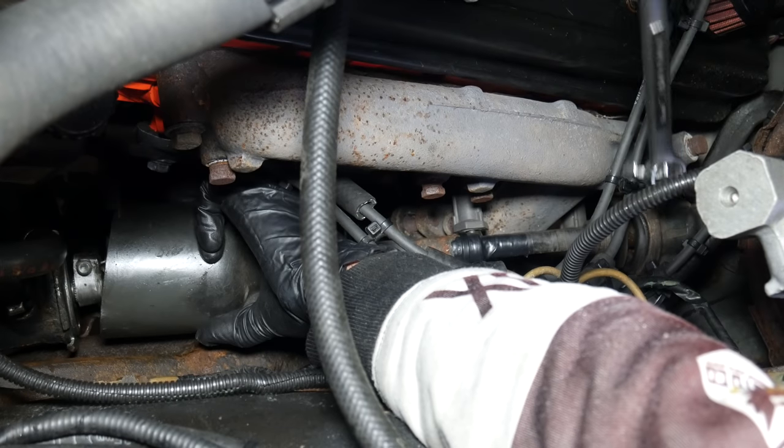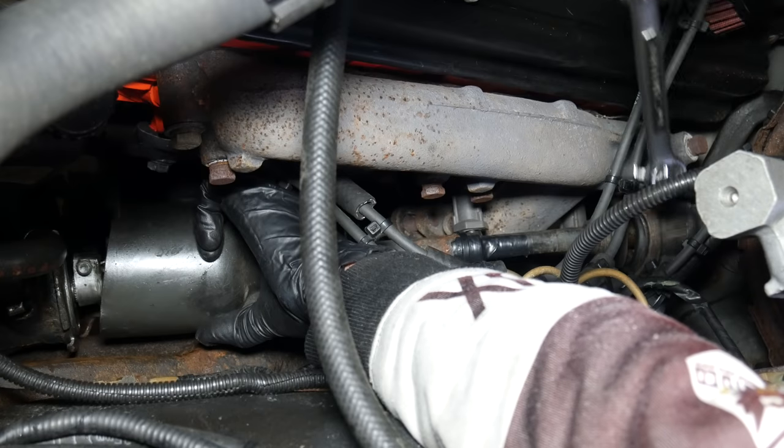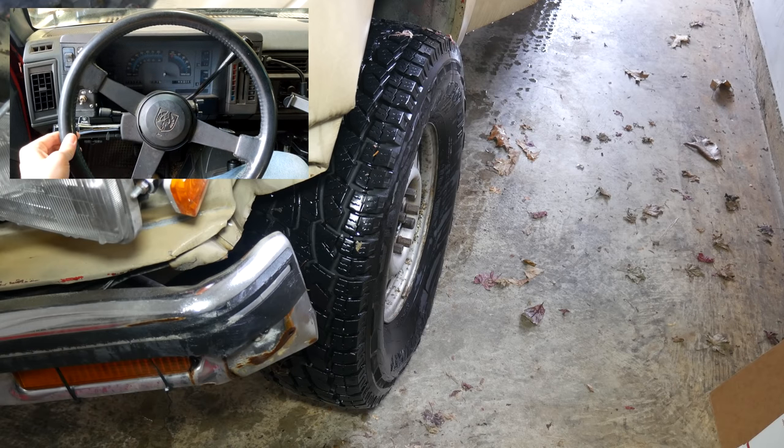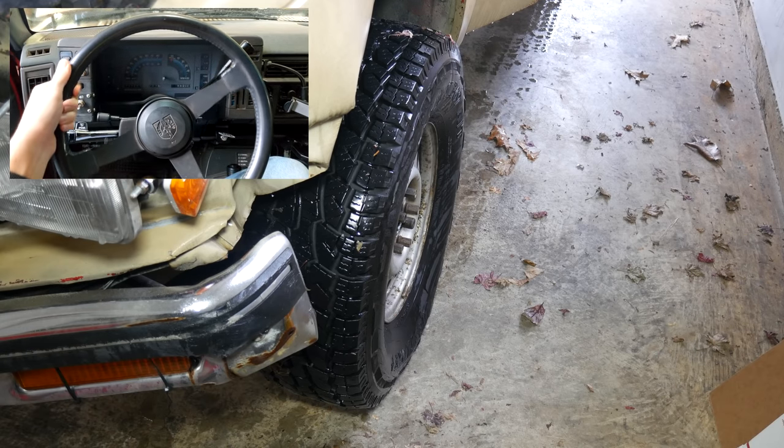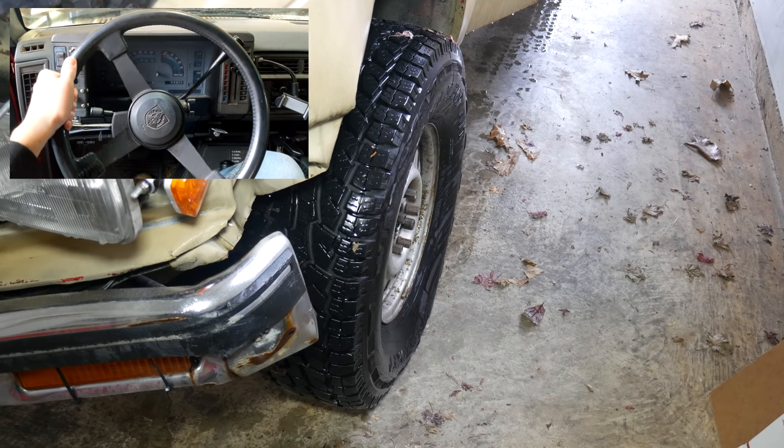And motion being lost is what we're looking for, since that's where the loose feeling of a steering system comes from. And as far as we can tell from here, the only places significant motion is being lost is from the tall tires themselves and that steering box.